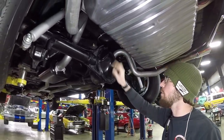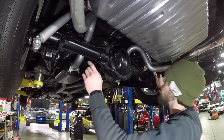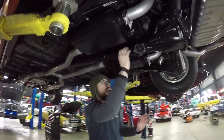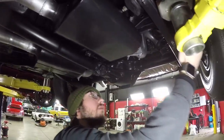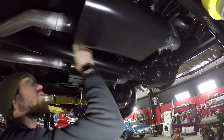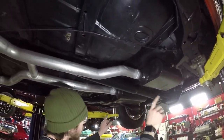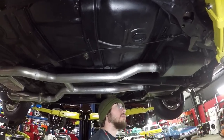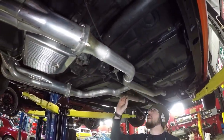For the rear end, this is a GM 12-bolt. The gear ratio is right around 3.60. It is indeed a posi as well, and attached to it are KYB gas shocks — way above what the stock stuff was. From personal experience it has turned a dump truck into a Cadillac. We also have Hotchkiss upper and lower boxed-in control arms, so that's a performance upgrade for sure. Moving forward, the driveshaft feels good, all of our u-joints feel good. Floorboards look like they're in pretty good shape. Full set of Flowmaster mufflers on this. I'd like to point out we do have drum brakes in the rear, but as part of our process we take them all apart and make sure everything is tight — check for wheel cylinders, misassemblies, the whole nine yards. The exhaust continues looking good with the mandrel bends all the way up into the H-pipe.